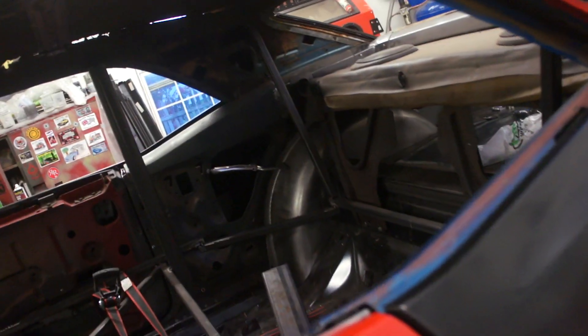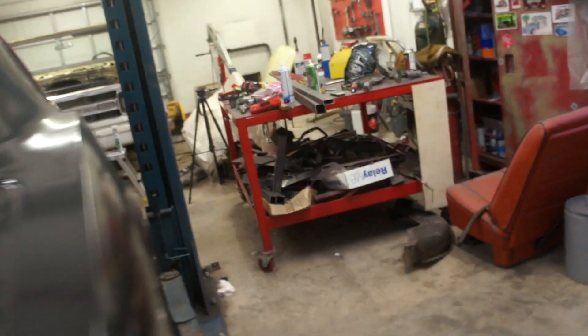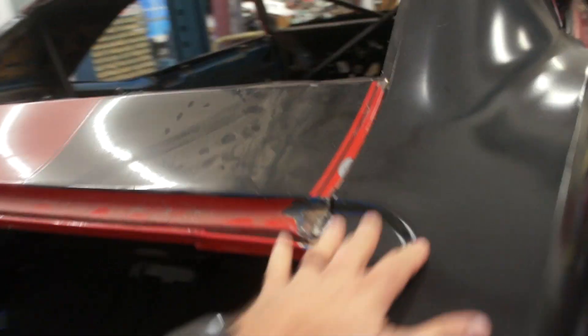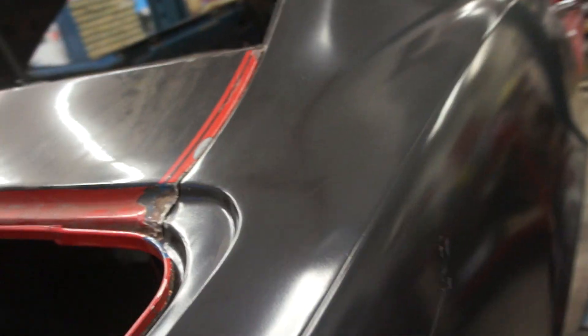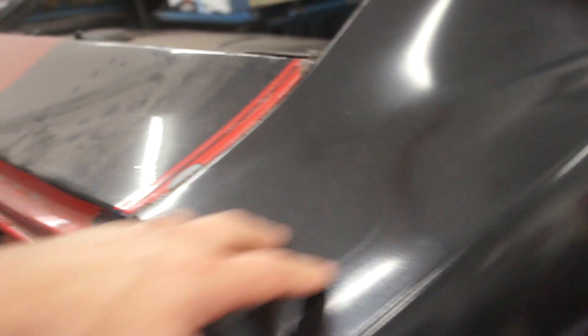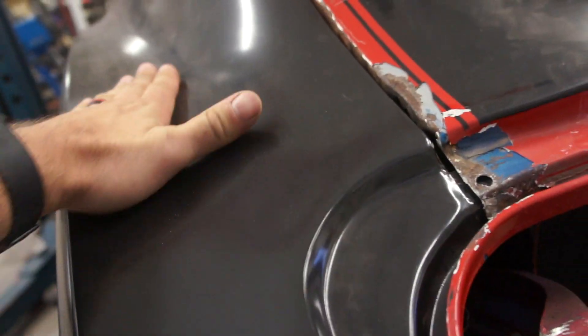If you've already welded it on and your quarter window is wrong, you'll have an 'oh shit' moment — you can't get your window to roll up or it's too loose. That's why I mocked the whole car up like this. There won't be any surprises. All these gaps look beautiful — straight off the get-go. There's a dent right there — same thing on Daryl's car. I replaced his panels too. It must be from the stamping because I had to fix that on Daryl's car and I'm going to have to fix it on this one too. Sure is the same on the other side.